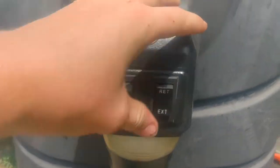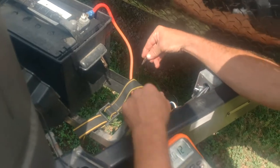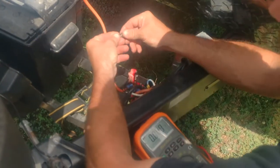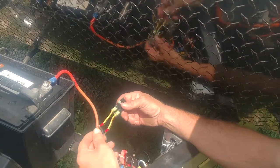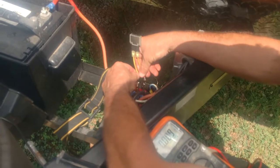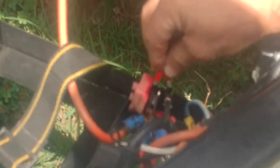I'm going to hit the button again and make sure it's not working. With the knowledge of this voltage drop right here, I can kind of cheat and make a jumper. With this jumper it's still going to have a breaker on it — I have this 20-amp auto-resetting breaker here and I just made a couple little pigtail leads for it. I'll stick it down in here with these little alligator clips. Hit the button, and it should work. Look at that right there.